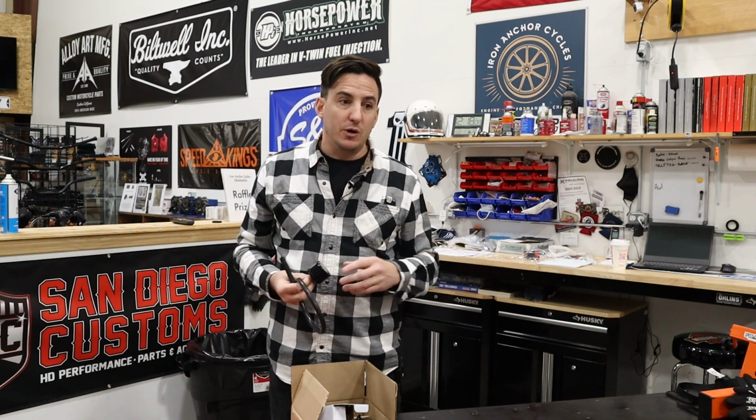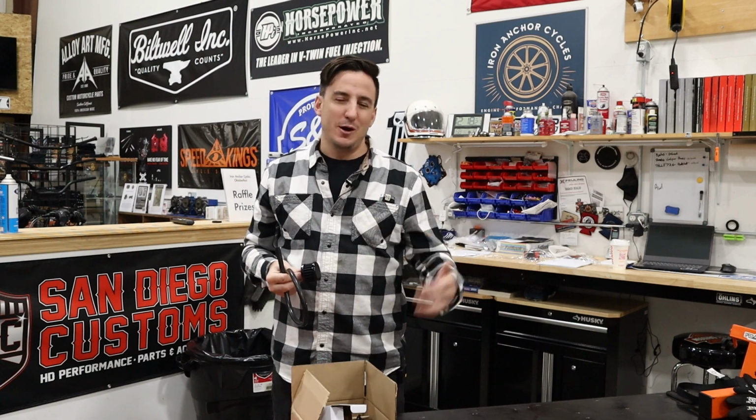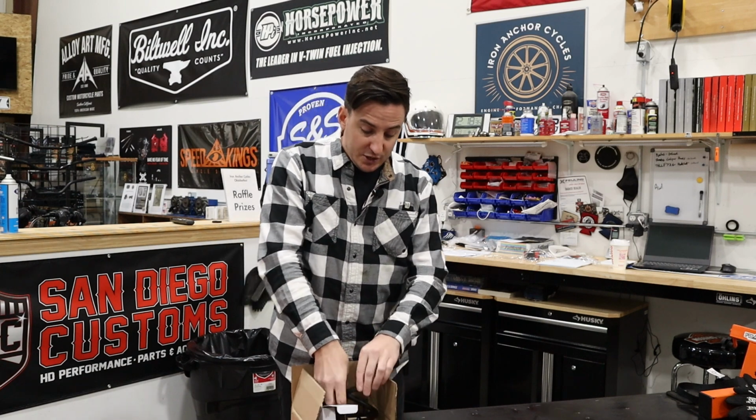But basically, I wouldn't go the route of saying I'm going to put external breathers on and not do this, and go, well, there's no more oil in the air cleaner, so I've solved the problem. You haven't solved the problem, you've solved your symptom, but the problem going on in the bottom end of your motor is still there. It's just been masked to a certain extent. So hopefully that explains the difference between the two. It's a question we get a lot when we're doing engine builds for customers here, so I thought it might be helpful. In any event, it's a great product.